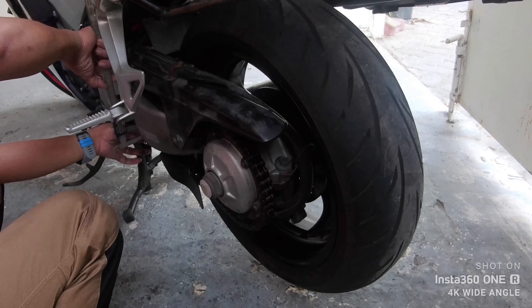So how can you tell if you need to change your chain? First indicator: there is a marking on your chain cover — the end of the sprocket tooth should not go past that marking. If it does, you need to replace your chain. You can also assess the chain itself. If it has excessive side-to-side play, you need to change it. And if you can see the rollers moving — stretched, compressed, stretched, compressed — they're going to be noisy.